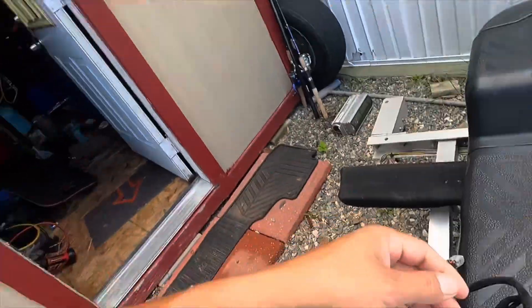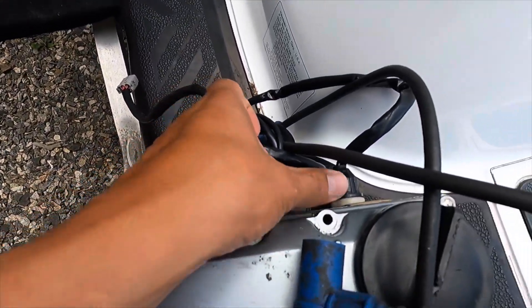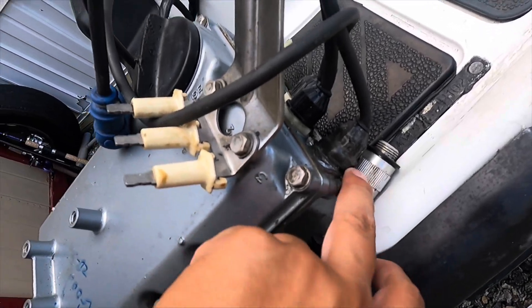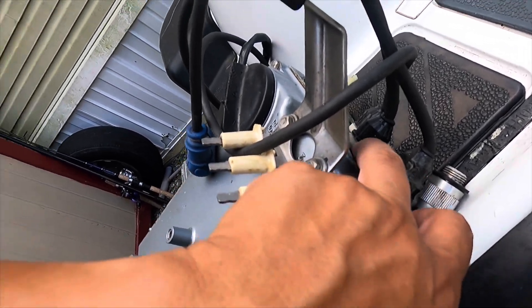The purpose of this video is: when you have these jet skis and you get water in it, make sure it doesn't get to the e-box. If you buy one of these, they go anywhere from $1,000 to $4,000 depending on how clean they are. Always make sure these little prongs are not broken — this little connector. This one's got JB Weld on it; I'll leave it like that. But these PVC connectors, whatever they're called — they break off, water gets in, and that's bad.